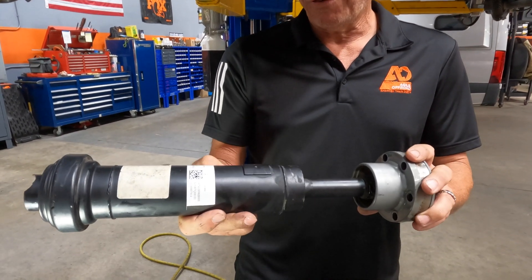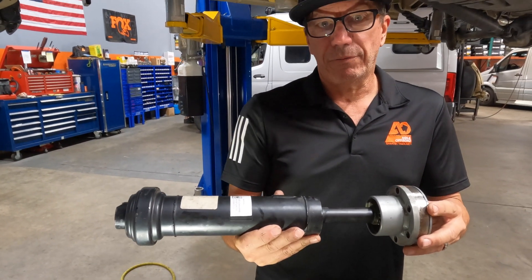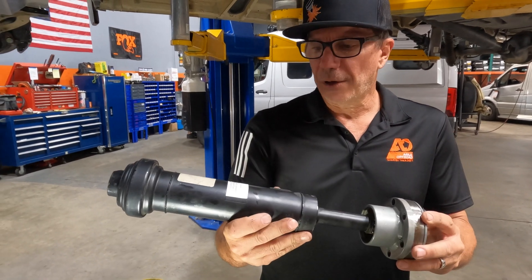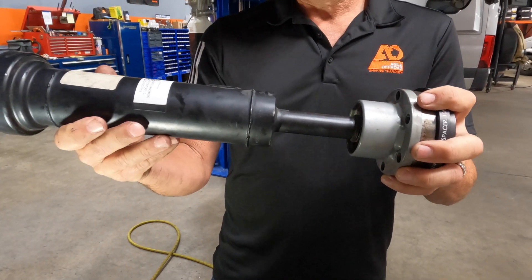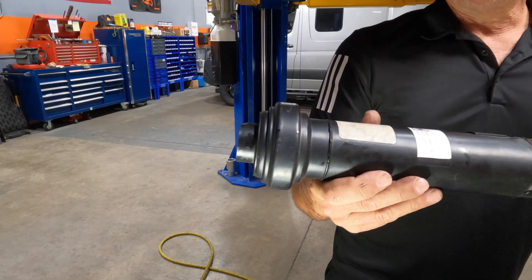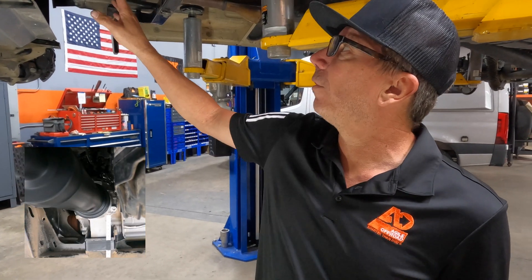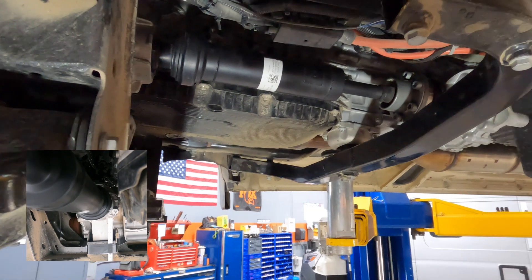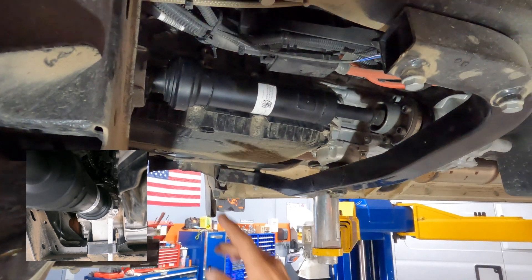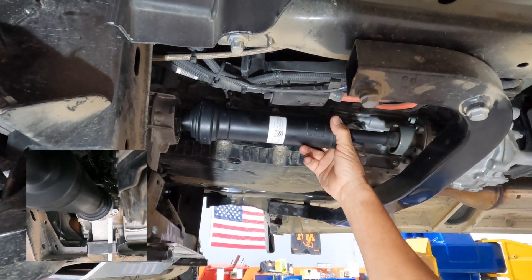Now keep in mind on the all-wheel drive, if you do have a front driveshaft fail, you can actually remove the driveshaft and you can still drive the van. So it still works without it. But we're going to install this spacer here — it's going to allow a little bit more give and free everything up. What we're feeling is that just off-road, we're getting a lot of movement in the front differential. We've installed a camera and we're seeing the front differential, transmission, transfer case, and engine all pivot. So we feel it's actually pulling on the driveshaft. I'll let Glenn show you how it installs — it's a pretty easy install.